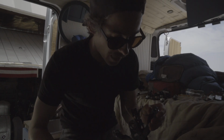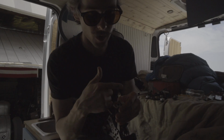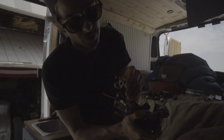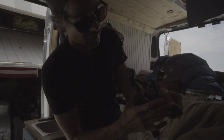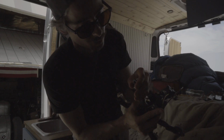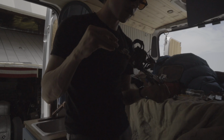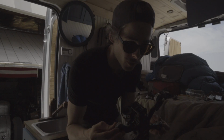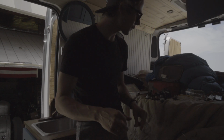The more you fly it, the more vibrations come from the motors. It's just inherent that you're gonna fly with a broken prop, or you're gonna fly with something that's gonna cause vibrations, and eventually it's gonna wear on the arms and they're gonna delaminate inside and begin to get twisty. And like I said, this quad is about 8 months old, and it's not in the best shape in the world, but it is super smooth, and this is the quad that I would want as my reliable butter quad if I were to go out and fly and I wanted clean video. And I have these quads over here that are freaking brand new.